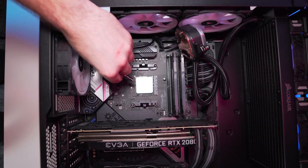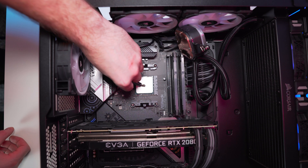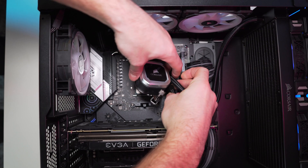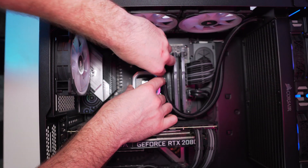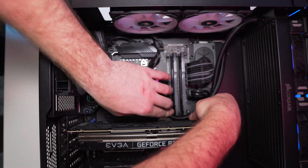After cleaning, I reapply some new thermal compound on top of the processor — about the size of a grain of rice. There are a couple of different methods people use, but I've stuck to this one and it works just fine. After that, I reattach the heat sink to my motherboard and I'm done. This process is great for an air cooler setup as well — cleaning off the heat sink and processor and reattaching it is relatively the same.